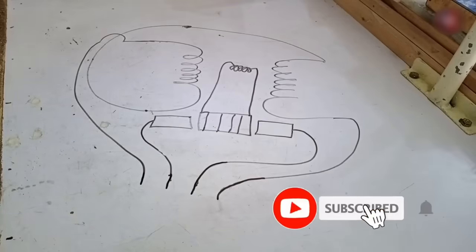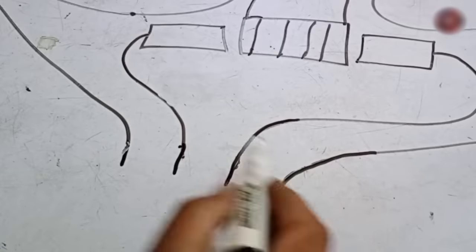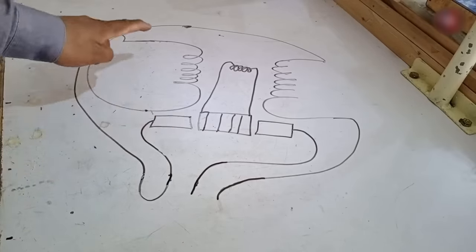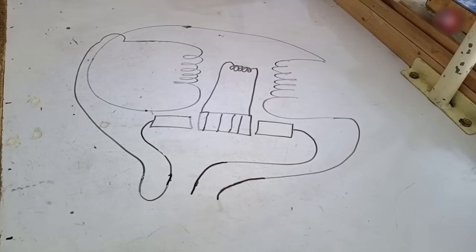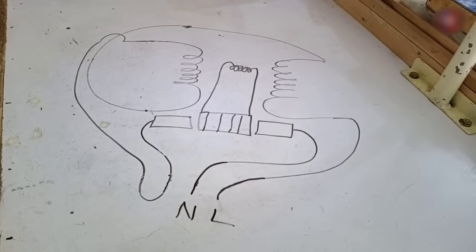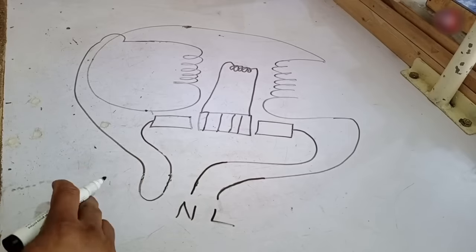So if we want to rotate the motor in any direction, we can do it easily. Take any one of the stator wires — either stator wire 1 or stator wire 2 — and join it with any one of the carbon brush wires. Be careful not to join both stator wires together or both brush wires together. Then pass neutral and line on the remaining 2 wires and the motor will rotate in one direction. But washing machine motors rotate in both directions — clockwise and anti-clockwise. To understand how, I will assign color names to these wires: brown, yellow, grey, and red — the same as on the actual washing machine motor.